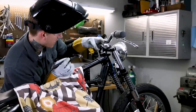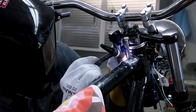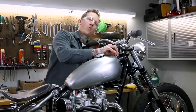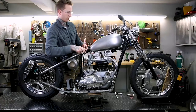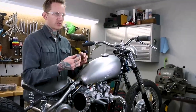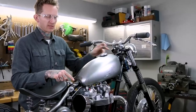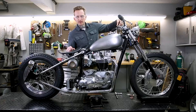Go ahead and get one tack. I've got the bolt, a washer, the tank, the leather washer, and then the threaded bung. It looks really nice. The way Todd wanted this mounted in the rear is using one of these one-inch diameter, larger-diameter coped bungs — for 5/16ths hardware, same size as the front. That cope is for a one-inch tube, like a handlebar — it's a perfect fit.